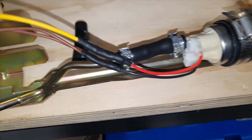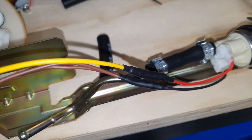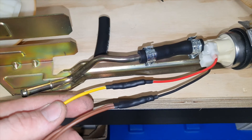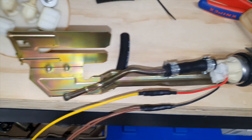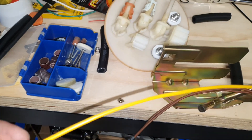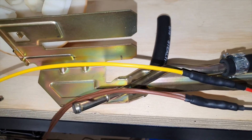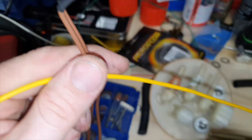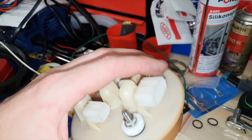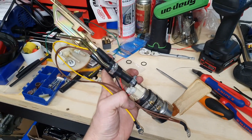Just a heads up - if you're doing in-tank fuel tank rewiring, you should go for the proper compatible heat shrink, not the black stuff, but I've decided to use it anyway for the extra layer. The wires will have triple layers of protection so it should be fine. The brown stuff is the stock standard wiring, which I've doubled up, and then I've used this yellow wire which is not PVC - apparently it's great stuff. The eyelet crimp terminals will just bolt underneath the top hat and that'll be good.